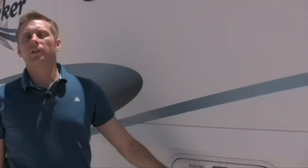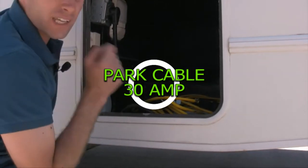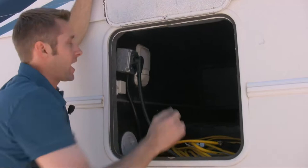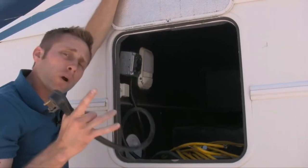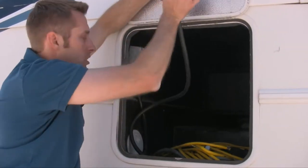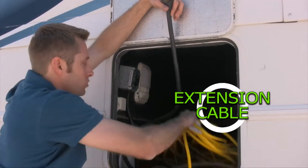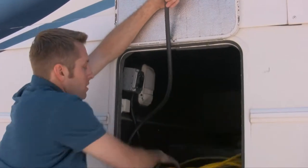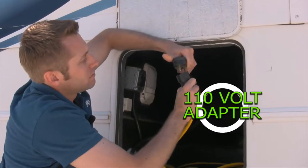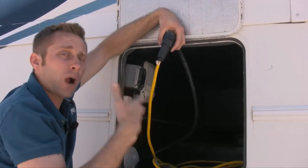Right here is your electric — this is where you plug in. To get power to your unit, you have one of two ways: either the generator or what's called park cable. This is a 30-amp system — keep that in mind. Most campgrounds will have 30-amp. If you're at a friend's house and don't want to use the generator, plug this into the adapter I provided and use only my heavy-gauge extensions. These support 15-amp, not 30. Plugging in will help charge your batteries and give you power.